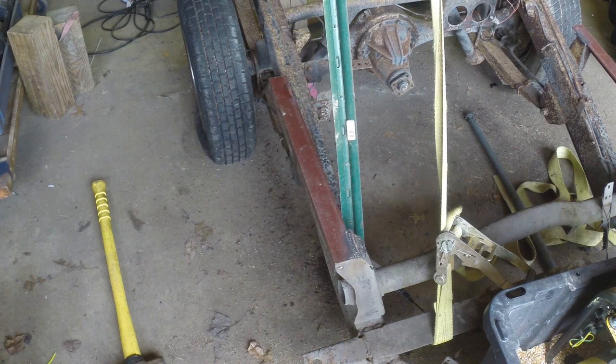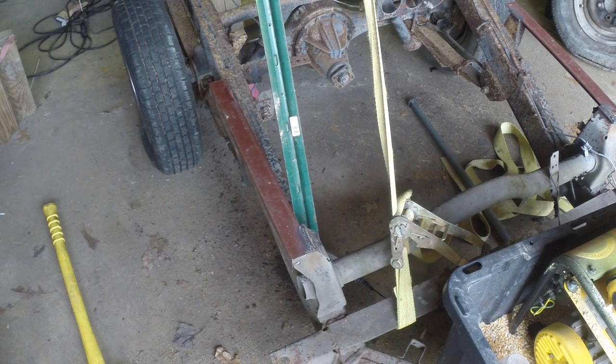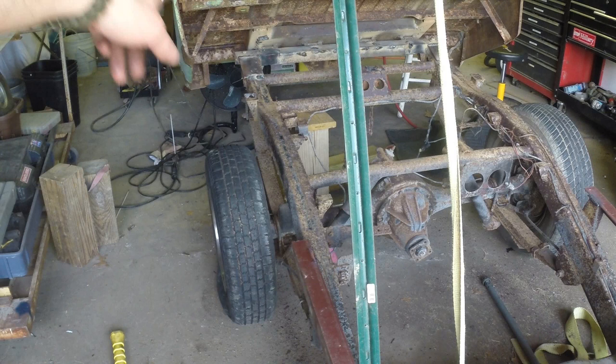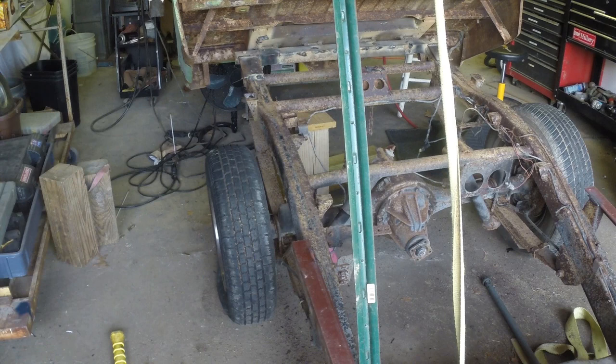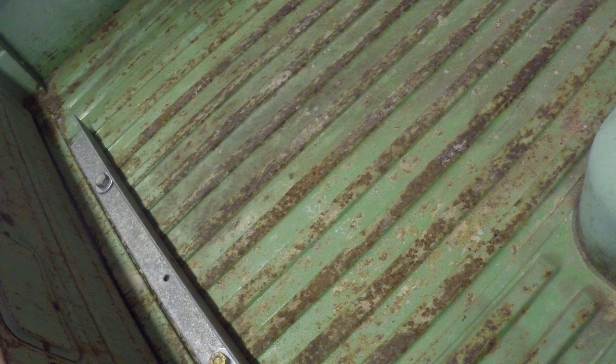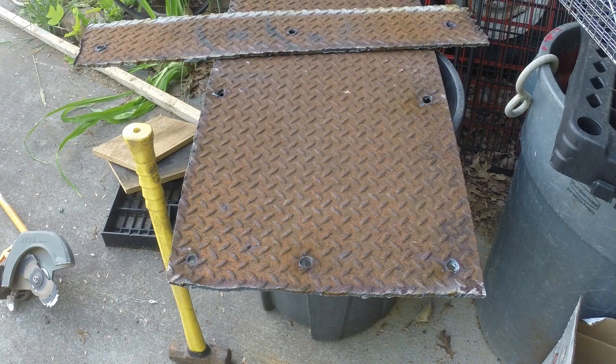It's a couple days later and I've got the dump trailer to the house, so I'll give you a quick update — this is probably still part one. Right through here I put a piece of angle iron because the bed was scooted forward a couple inches and it was missing that. Back here I've added the hinges I was building, and I came around and added supports and welded it all up, putting big three-quarter inch bolts through it. For some reason I wasn't thinking when I made the plate for this side — I threw a piece of angle iron in there thinking it was going to be at the top but it's at the bottom, so I'm going to try to pull that piece out and put it in the shop press to flatten it.